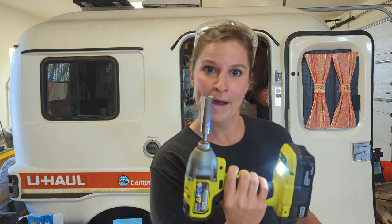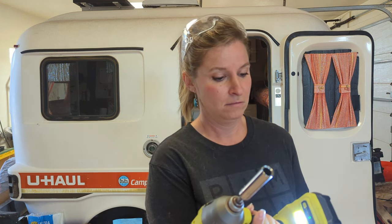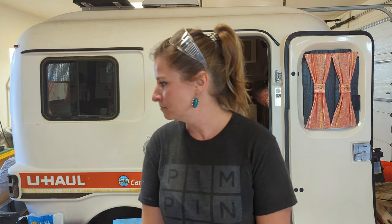Another thing I should have done from the beginning: when my dad handed me the impact wrench, I should have started with that from the very start. The impact wrench gives you the right amount of pressure so you're not going to break the bolts, and it also jiggles them, rattling some of that rust loose so you have a higher probability of getting them off easier. When I hand-ratcheted, I was doing it too hard and that's where some of them snapped. It's really beneficial to have the proper tools. My dad also had to help despite having pulled his back previously — I feel terrible about that.